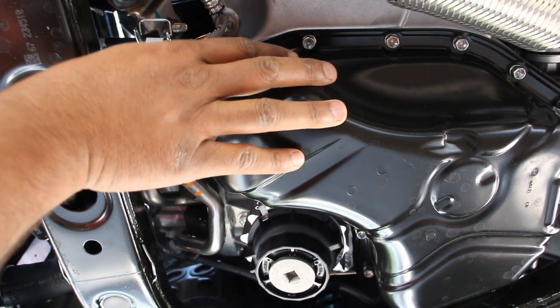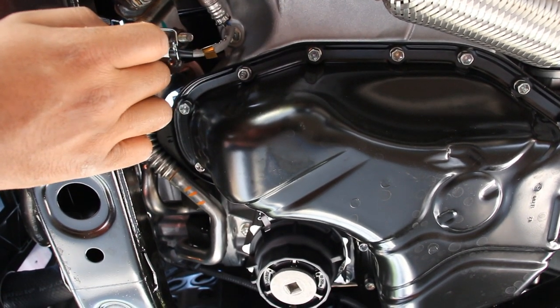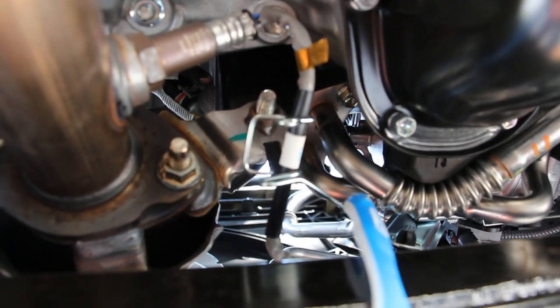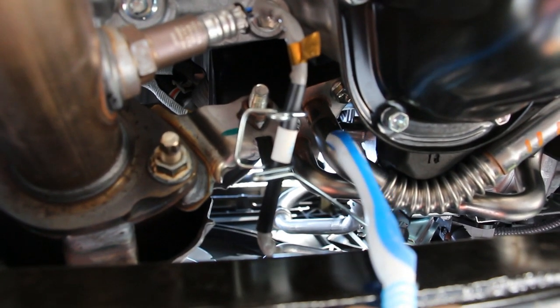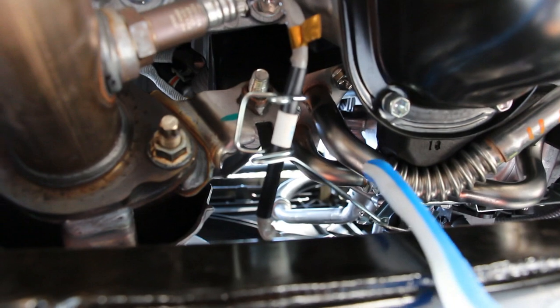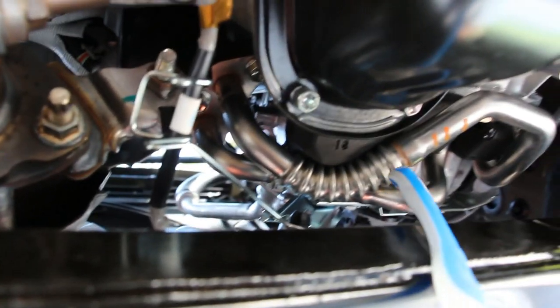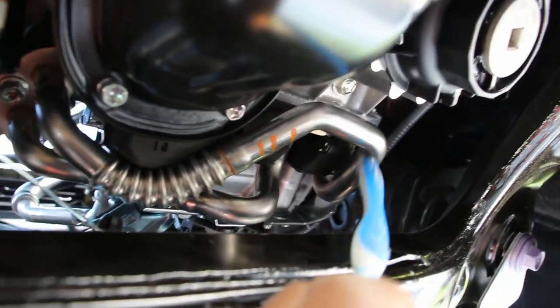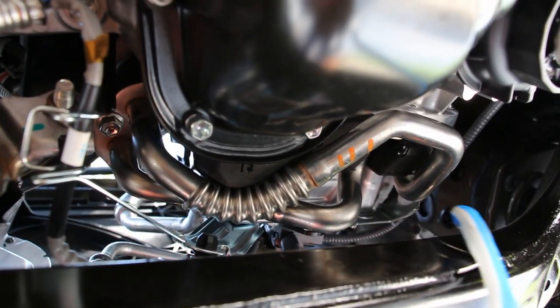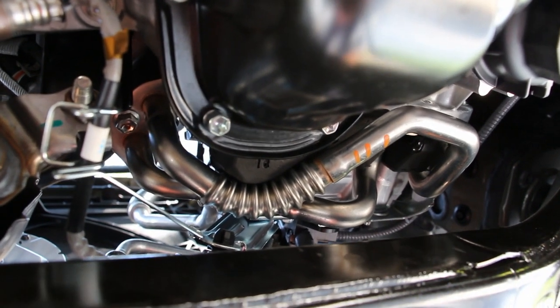This uses a steel lower oil pan that bolts to the aluminum upper oil pan that ultimately attaches to the block. Looking up underneath the front manifold, you can see this is where the oil cooler is located — it's just a heat exchanger that draws oil out from the engine and cools it off. They have these two oil supply lines here made of metal that bring oil out from the block; on earlier 2GR engines these oil lines were made of rubber and they would burst, causing an oil leak.